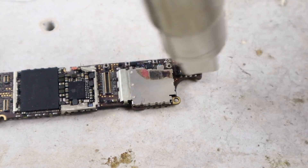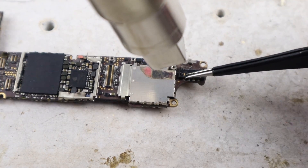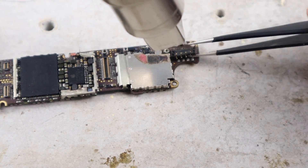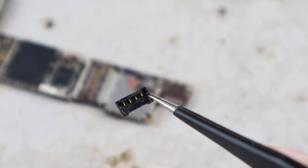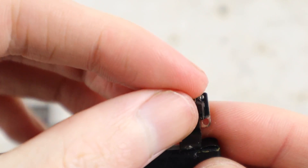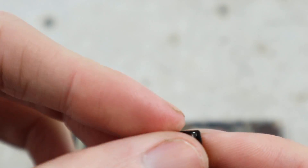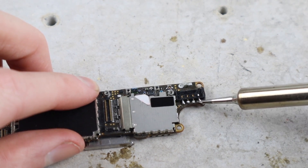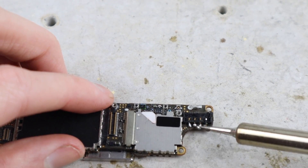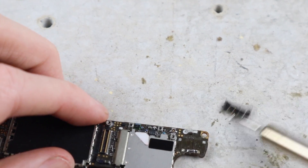After feeling confident I got a non-working iPhone 4s logic board and desoldered a few components, beginning with the battery connector which I'll transfer across to the 4s with the missing connector. I tested it after removal to make sure it could still connect to a battery, because in my previous attempt I melted the connector so it would no longer clip in. Once I confirmed it was still functioning I began to desolder the old bad battery connector from the 4s.